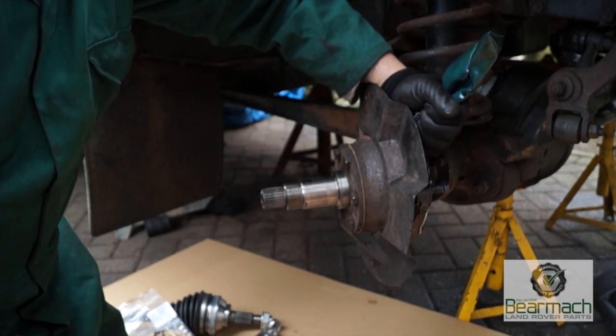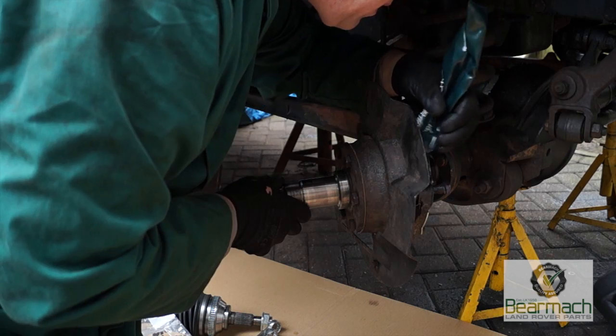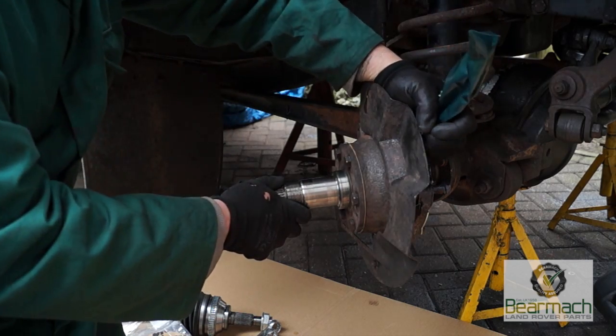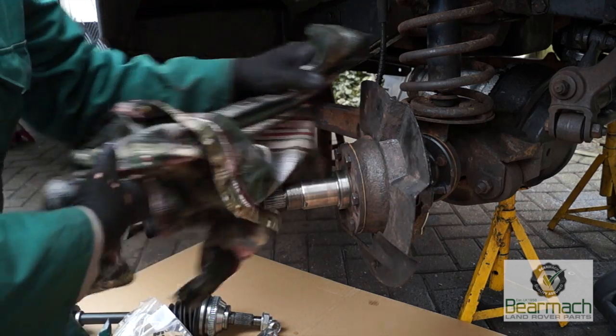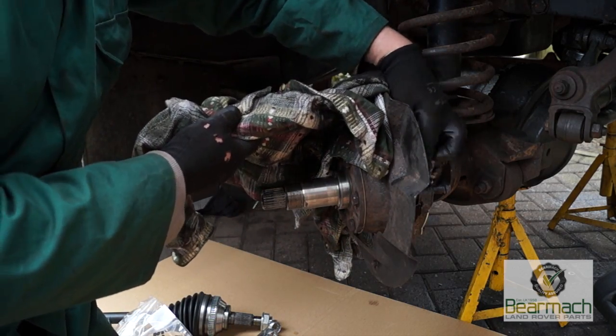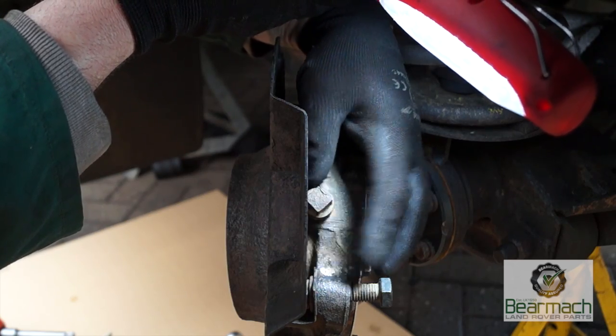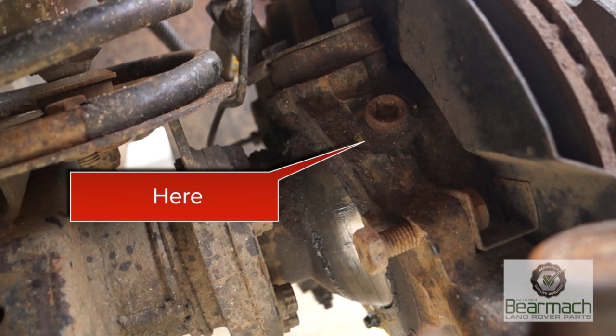Okay, if you've got a later vehicle, the stub axle actually has a seal in there, and when you fill up your one-shot grease, it will not come out through the stub axle. Earlier ones will, because they will be oil filled. As I said before, you need to turn the swivel housing to full lock to be able to get the grease into the housing. The square drive here, you can use a 13mm spanner. On later Defenders, this is a 3/8 drive which you can use an adapter for to unscrew.